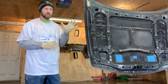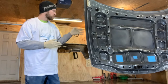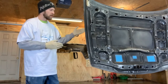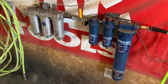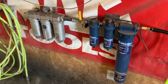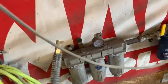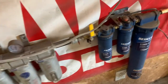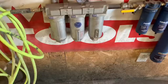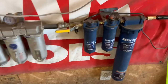The main thing with a lot of guys in their shops is that their air is not the greatest. What I've got is two three-stage filters feeding into my paint line. How I have this set up is not really ideal, but for an at-home setup, I have my shop air here and I just plug it in, and then I have a valve.